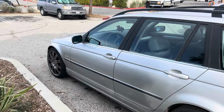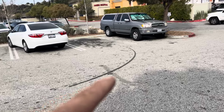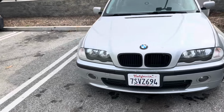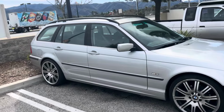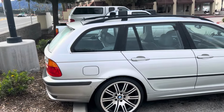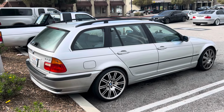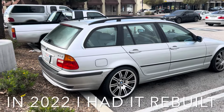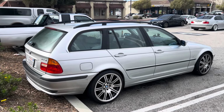So the disc, this left front wheel, you can see the original trail. Coasted into that spot there. From that point on, it just stopped moving because it ran out of fluid. Love the wagon. Last time what happened was the converter ballooned, took out the pump seal, and I have a feeling the same thing happened again. I think last time that happened was in 2021. Got it fixed. Got a tow truck on its way right now to get this thing repaired.